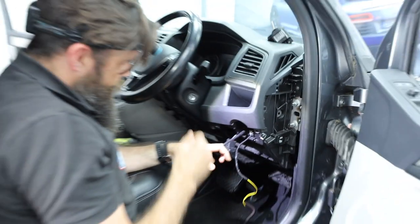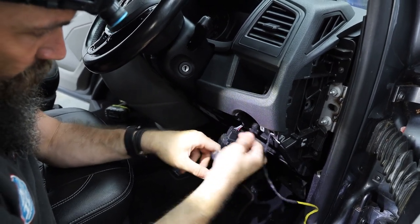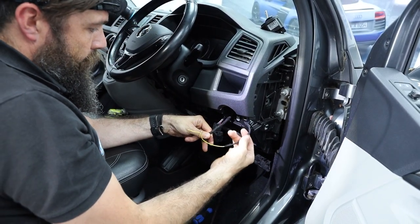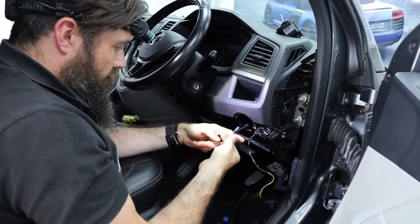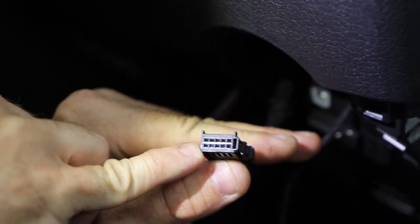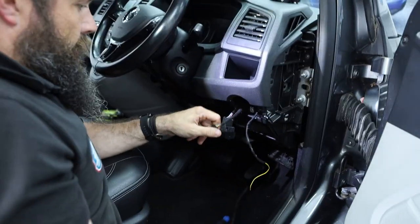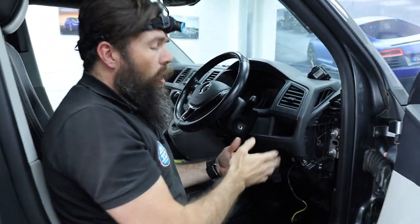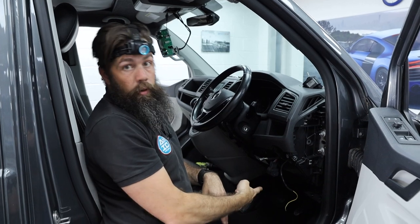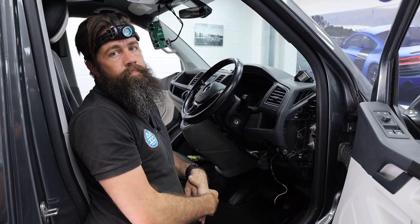We're going to cut past all this cloth taping — someone's been here before and done a good job. We'll tap this cable onto the lighting circuit cable, which is pin number 10 — the gray-blue wire. As I show in the footwell video, it's worth watching that one too. Tapping the yellow fly lead onto the gray-blue means that when your lights come on — either on auto or manually — your ambient lighting comes on alongside your interior and footwell lights.